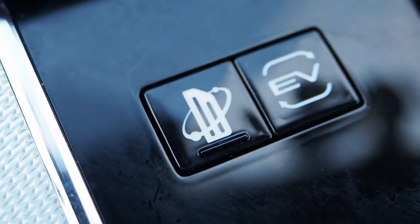Second feature: one-pedal driving. We engage that right down here with this button. When that system is off, releasing the accelerator just makes the vehicle coast, which is probably what you're used to. When you turn it on, releasing the accelerator has the same effect as moderately pressing on the brake pedal. That means using one pedal, we're able to regenerate more electricity — the wheels drive the motors, creating electricity to charge the battery, and we only have to use the brakes to roll to a complete stop.